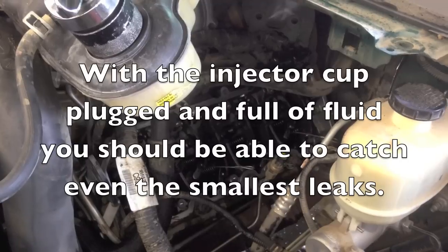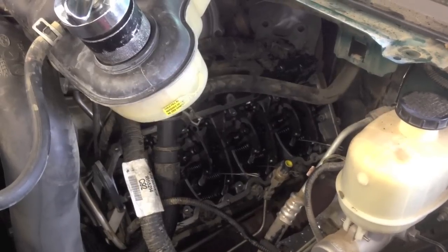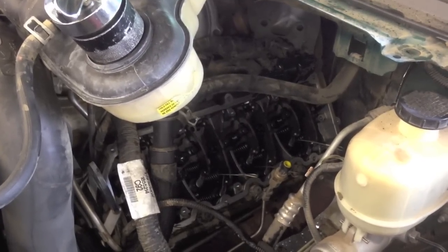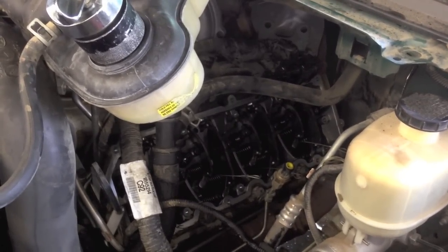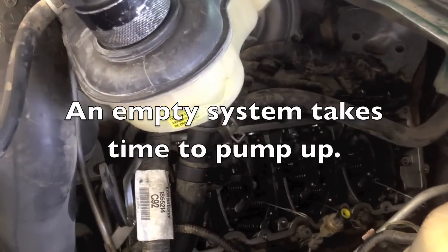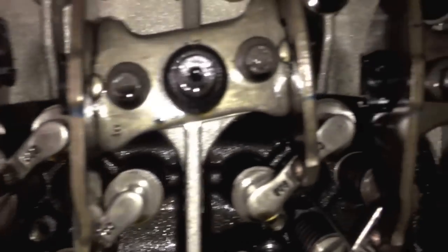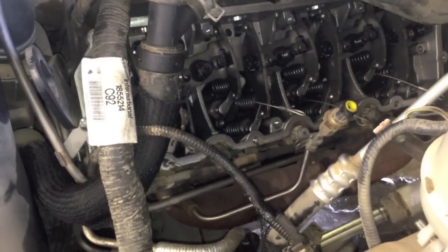It takes their kit because they give you stoppers that you put inside where the injectors go. Once you put the stoppers in, you fill up the area with WD-40 or something that won't harm or damage the block. If you use water it might end up rusting or getting water into the engine. I've got the cooling system pressurized and you can look down inside and look for air bubbles. On the driver's side I've had it pressurized for about a half hour - no signs of any air bubbles.